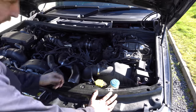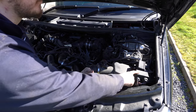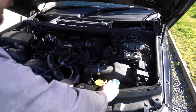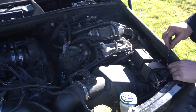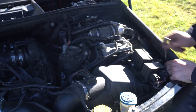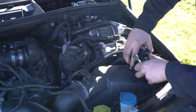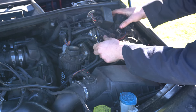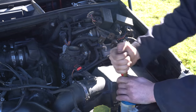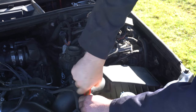The right-hand side was the easy one. The left side is a bit more tricky — we've got these glow plug relays on top, which need to come out of the way first before we can get into this filter. There's a single 8mm bolt that holds the bracket these sit on, so we'll take that out and wiggle the whole bracket out of the way, tucking it up on top of the fuel cooler so we can get at this filter.